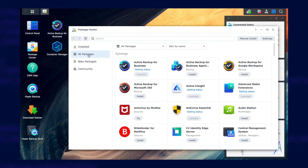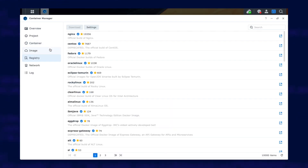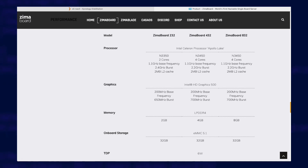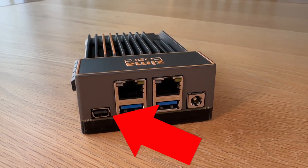To summarise: if you are looking at getting into the world of home servers, you have a choice. You could go for a NAS like a Synology, where you slot your drives in and use a selection of built-in apps, and maybe experiment with Docker containers if you're feeling adventurous — but that will cost you around £500 plus your disks. Or you could get a Zima Board for about £170, or less if you go for one of the lower specification models. You can plug disks in if you want, either USB or SATA. CasaOS will give you a great starting point for playing around with Docker containers, and has the manual install option for when you've got to grips with it. When you're really familiar with Linux, you can install your own favourite Linux distribution, or even Windows. It has a DisplayPort output, so you can connect it to a monitor if you wanted to use it as a compact PC or a media player.